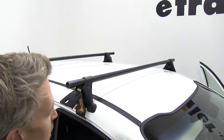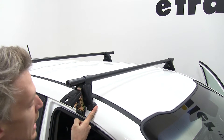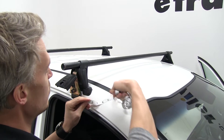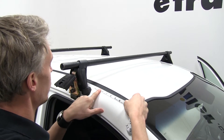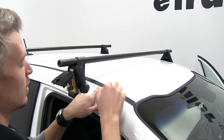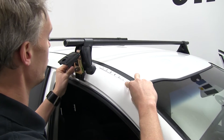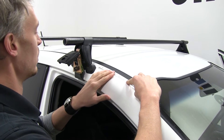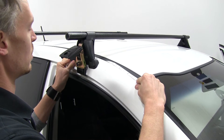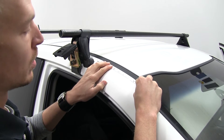To start out with, we're going to need to make sure that this is 7 and three-eighths inches from the Q-tower — from the pad here to our windshield. I like to use this line for guidance. We'll make sure this is lined up with our Q-tower, then come down and look for 7 and three-eighths. So we need to move this down a little ways, and just a little bit more. That looks about right.